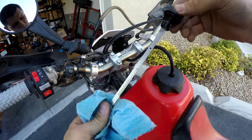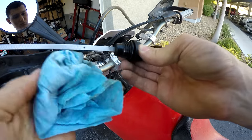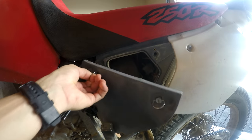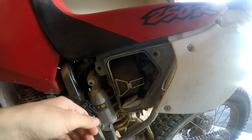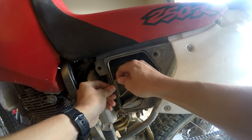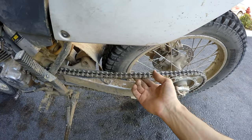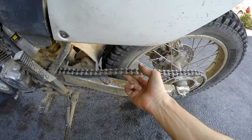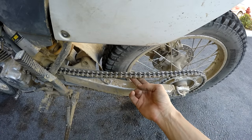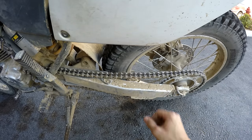When I do it, I simply stand by the bike and hold it completely upright for five minutes, and that always gives me a good reading. On the other hand, the air filter is one of the simplest ever to perform maintenance on. The air box has a door on one side — by simply opening this door, the air filter can be accessed and removed. The only other maintenance is to replace the drive chain, sprockets, and tires as needed, and sometimes lubricate cables or grease the steering stem bearings and rear suspension linkage bearings when they start to feel a little clunky.